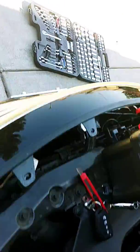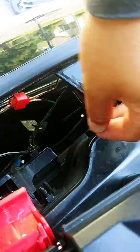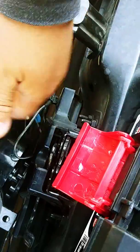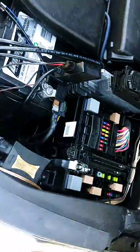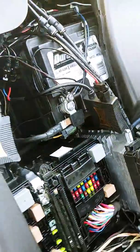Now I have my working train horn and regular horn. I've got a relay, and everything you can think of under the sun connected up to different wires — old wires I had lying around from when I used to do installs years ago. So a little fuse right here. 2015 Sonata — it's supposed to be 20 amps. Right now I can honk it at 7.5 amps. I'm going to switch it out to what it needs.